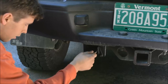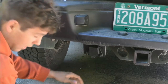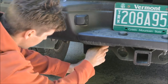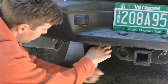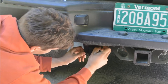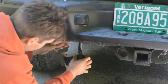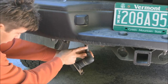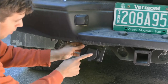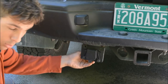This is your 7-pin connector, right where you can plug a trailer in. To make my life a little easier, I'm going to let it just hang down so I can get the plastic shielding a little easier — there are just two bolts at the top. Now it's hanging down. There's plastic shielding right here which I'm going to need to cut into. Luckily, your wiring diagram, or pinout, is right on the cover — so remember that if you're going to tap into this yourself, all your wires are right here.